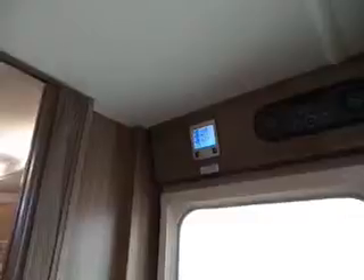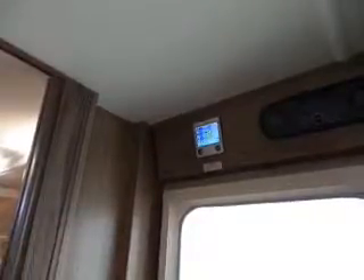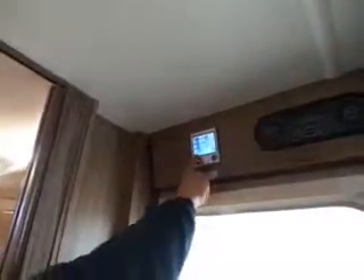Press the menu button to adjust settings. The top option is room temperature — adjust with plus or minus, maximum 30 degrees, minimum 5 degrees. To effectively turn heating off, just set the temperature below the current room temperature — the circulation pump will stop. The next menu option is water heating: press plus for normal running (half-triangle), press plus again for boost (full triangle), which concentrates all heating on the hot water for 30 minutes, then reverts to normal. The energy menu lets you choose electric — off, one, two, or three kilowatts — or gas on or off.